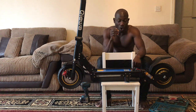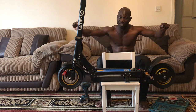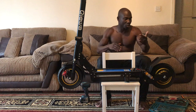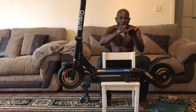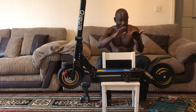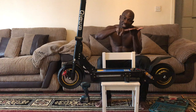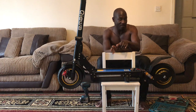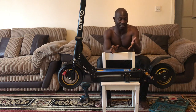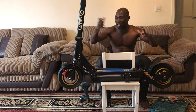When you see that, all you have to do is use the same system. If you think the silicone is making it hard for you to separate the connectors, just use maybe a slight screwdriver or a knife to scrape the silicone off. Don't cut it. I'm not going to advise you to cut through, because you might end up cutting something. So just scrape the silicone off gently. It doesn't matter how long it's going to take. You would rather spend more time to get your thing working than to rush and spoil it. Just scrape it slowly, and once you're able to loosen it, that means you can connect a new one.